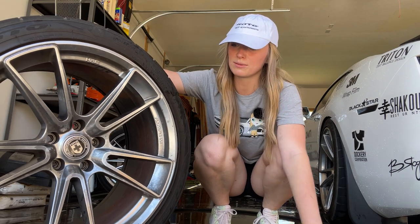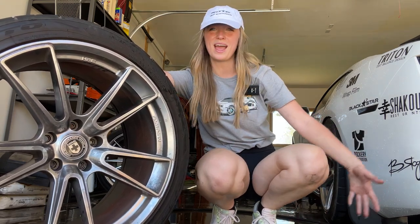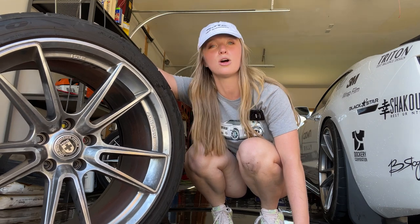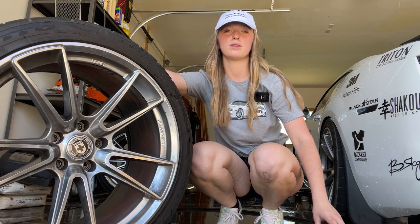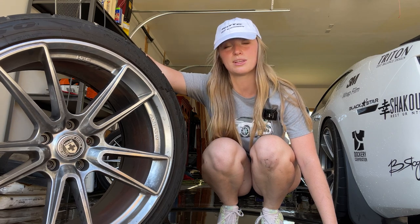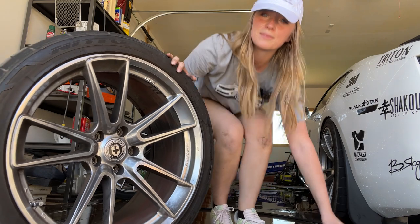There's no way to really get around it if you use your wheels and your brakes the proper way and drive the crap out of it on the track. I'm gonna use Diamond Bright, which is a strong all-purpose cleaner. It should strip everything off these wheels, and I wanna ceramic coat it with the Gtechniq Wheel Armor and see how that protects it, which is more of a high temp ceramic coating so it'll last longer. And hopefully this kind of stuff won't stick on my wheels any longer.